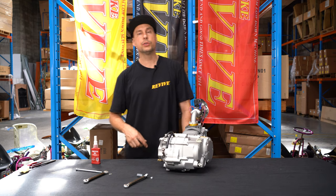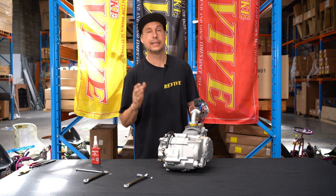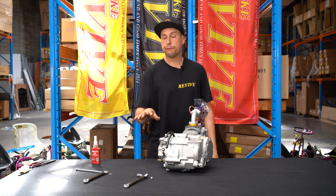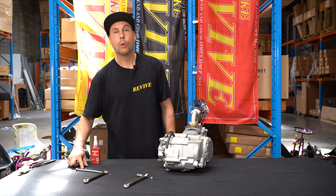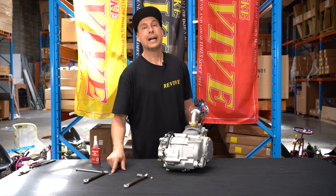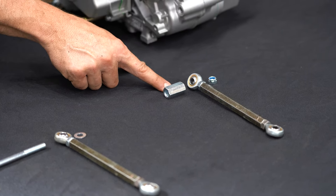The last thing we want to do in order to get our engine ready for assembly is fit the engine tensioners. It's important to fit the engine tensioners now, before the engine goes into the frame. Otherwise, these are near on impossible to fit later on. To fit the engine tensioners, which come in the kit, you're gonna need a 160 millimeter long M8 hex headed bolt, your two engine tensioners, an 8 millimeter ID washer, the 10 millimeter coupler or joiner nut, and